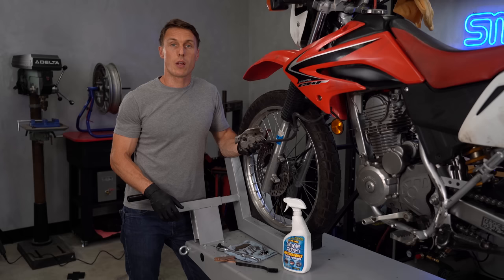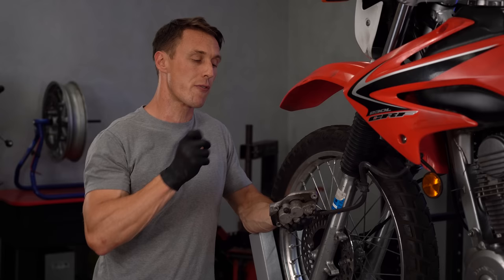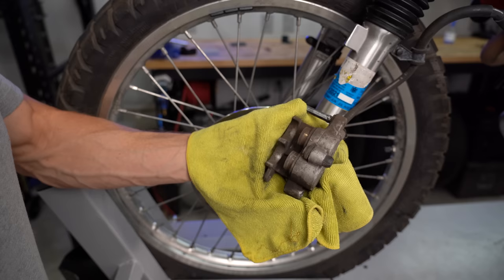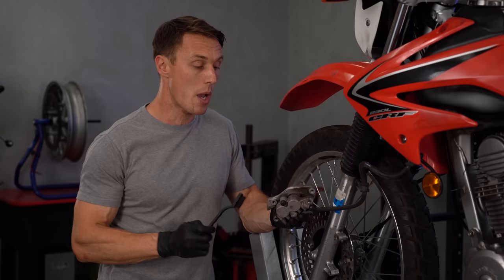Now let's look at the caliper. As your brake pads wore down, the pistons extend out, and we'll need to push the pistons back in to fit the thicker new brake pads. However, the pistons are covered in dirt, so if we just force them in, that crud might damage the piston seals. So we're going to clean them with a mild detergent like Simple Green or just soapy water and a soft brush. This isn't something most people do, but it is an important step to ensure your brakes work well and work for a long time.